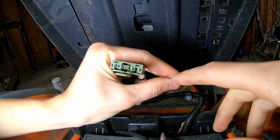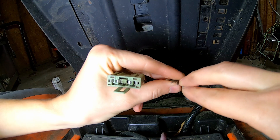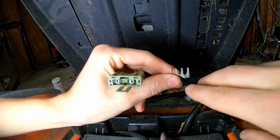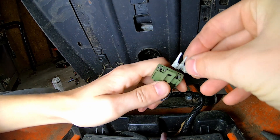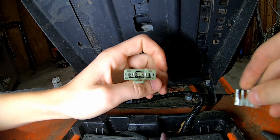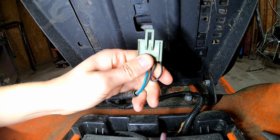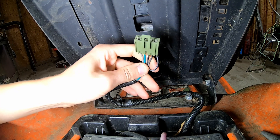When this connector is connected, the wedge depresses the tangs so that they don't short anything out, and it's controlled purely by the seat switch. When it is pulled out, everything's shorted to ground. So now that the shorting bar is taken out, it's essentially bypassed and you can start and run the mower with this unhooked.